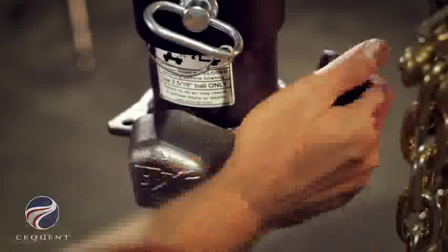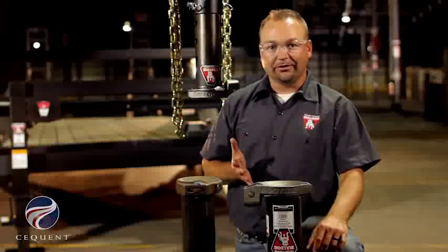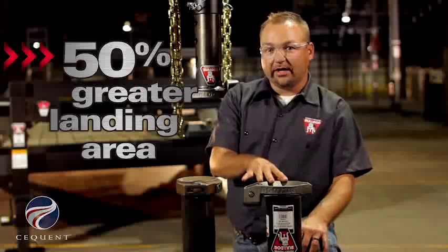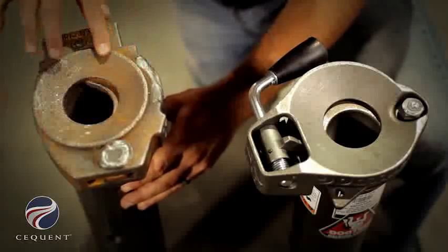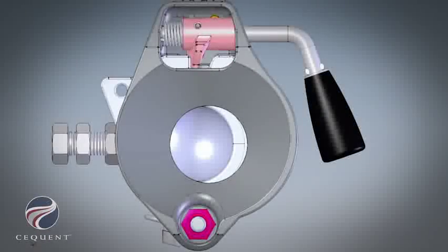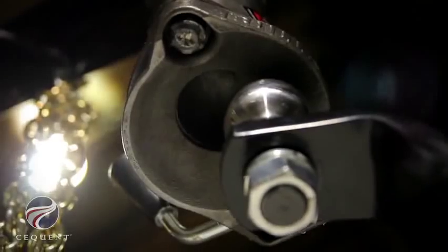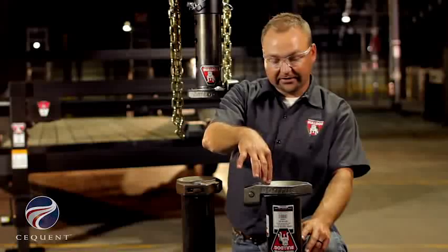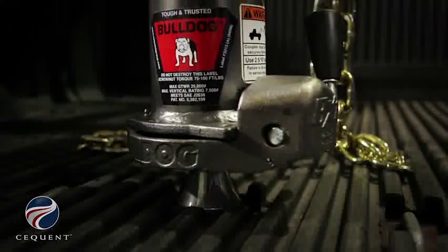Another feature is the one-handed operation. One of the great new features about the BX1 Gooseneck Coupler is the increased landing area. The BX1 Gooseneck Coupler has a 50% greater landing area than our competitor. The increased landing area is particularly important when hooking up and trailering — the larger area allows the end user to be off by nearly one inch when hooking up the ball, allowing the ball to hit off to the side and slide in and fall into the ball pocket.